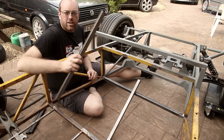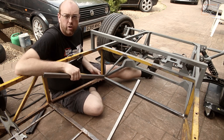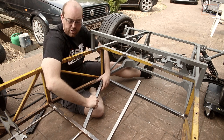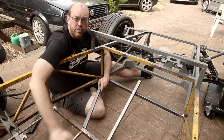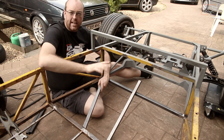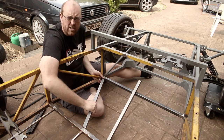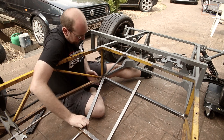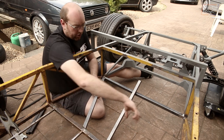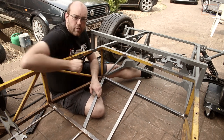It's another day, the sun's out, we're in shorts, and we've been making these cross braces. They're going to come down from this corner off the new cross piece and lead back into the floor, where we're going to have some sort of tunnel — and they'll transfer any forces through, actually stiffening the chassis laterally a little bit, because everything else is straight back. We've cleaned these up and we'll get them welded into each side, then join across here and build something in the front to take our pedal box, fuel tank, and a few other bits and pieces.